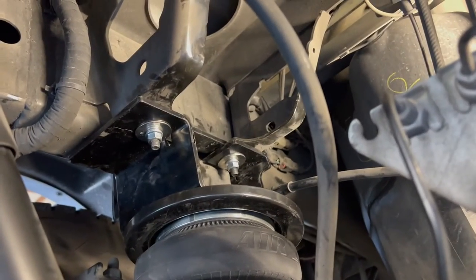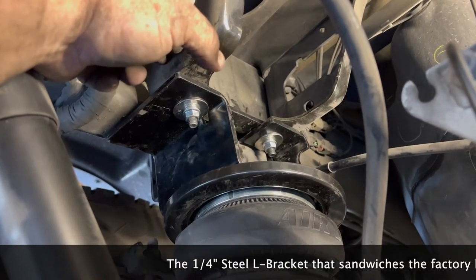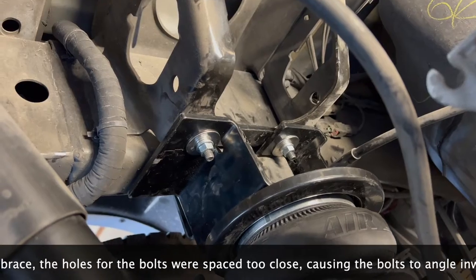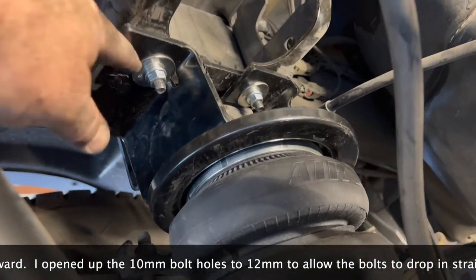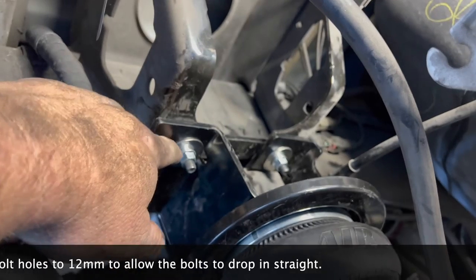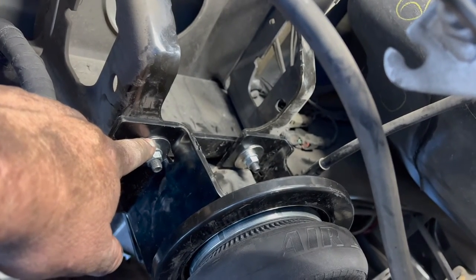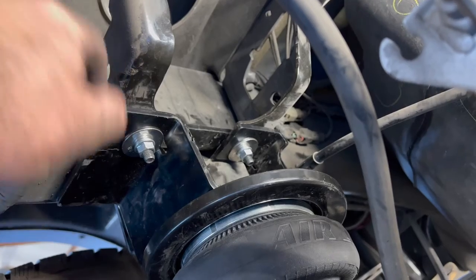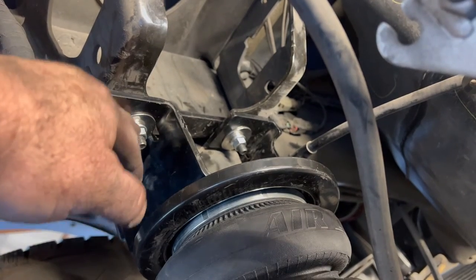I've gone almost the full length of that slot — now it's straight up and down, so I'll tighten up all the bolts and the right side will be done. On the left side, the angle bracket holes were drilled too short to fit the existing factory holes, so the holes had to be enlarged one step with a step bit. We used the pry bar again to pry the plate out so the bolts would fit. The kit doesn't come with large stainless fender washers — that's something I added along with a lock washer on the serrated flange nut so it won't vibrate loose on New York roads.